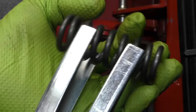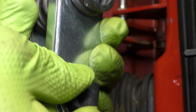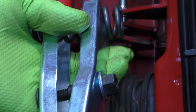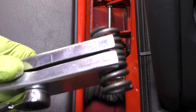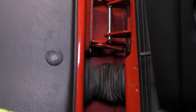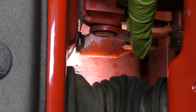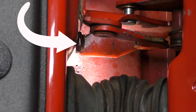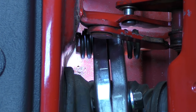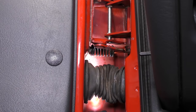We've got to put our spring back in. If you did this the smart way, you didn't take the spring out of the tool. Because this is a new spring, we're going to have to make exceptions — get that spring all the way down in your tool. When you go to install it, you want the nut or bolt to be towards the body side of the truck to give you a little more room. Compress the spring by tightening down the nut. Get that as compressed as you can. Make sure you don't put the tool on the outside of the spring. Then between this arm and this little tab is where the spring is going to go — just rock it into place. Once it's in, loosen the bolt with your ratcheting wrench and your spring is in.